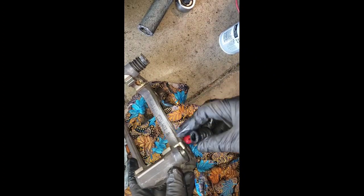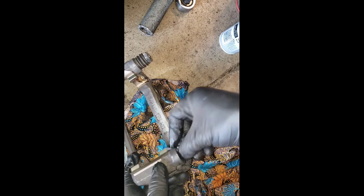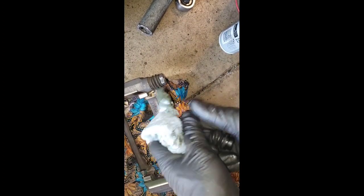So I'm gonna put my boot first. When you take it out, just be very cautious. You don't want to rip it off. If you do, you have to go buy a new one. There we go, right there. And then just slide the pin right there, greased already and clean. Go slowly so you don't get any trapped air inside. There you go. And if you do, just pop the air a little bit out. There you go. Right there, you see.